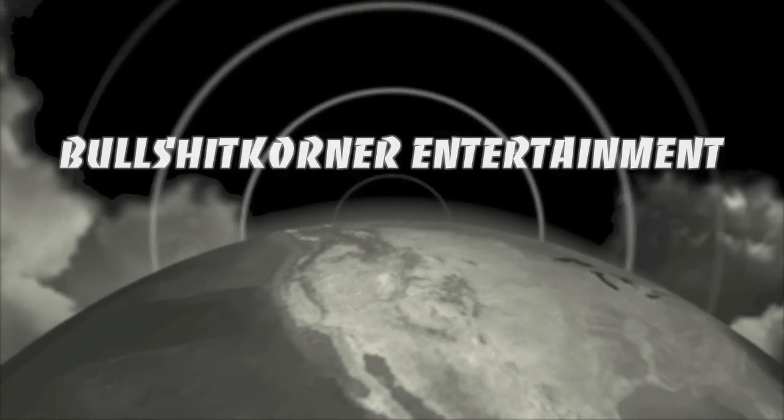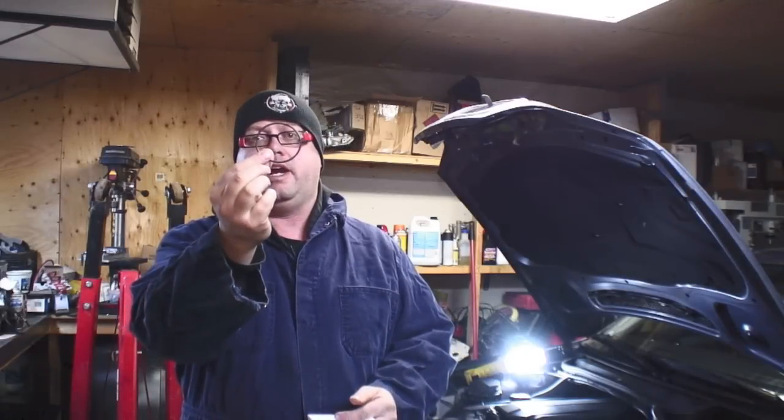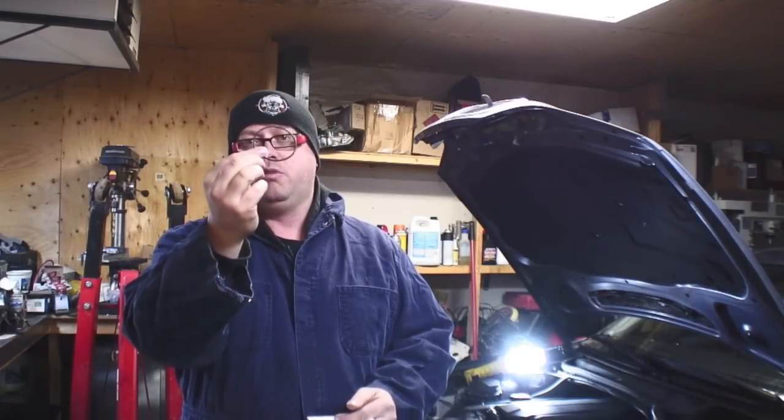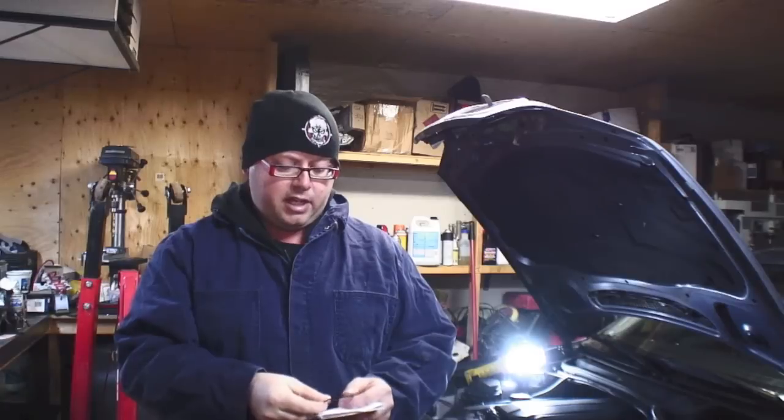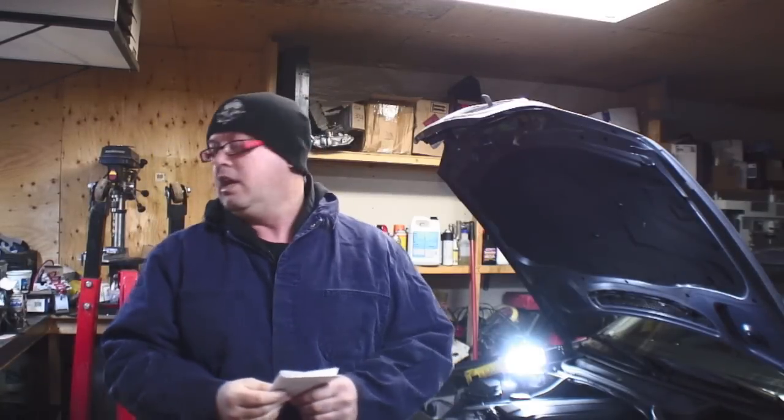In this video, we are going to replace a Disa valve O-ring gasket. The only reason we're doing a video on this is because I got a nasty vacuum leak somewhere that I can't figure out where it's from. We recently changed out the CCV valve, so that only leaves a few places where I get a vacuum leak: the Disa valve gasket, the O-ring on the oil stick, and perhaps the intake boot.